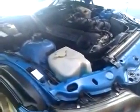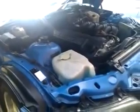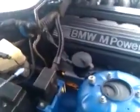This is an S50 M Roadster, S50 B32. Apparently the constant pressure valve is not on the S50 B30 — it's only on the S50 B32 engines and the S54 engines. It's located down here somewhere.